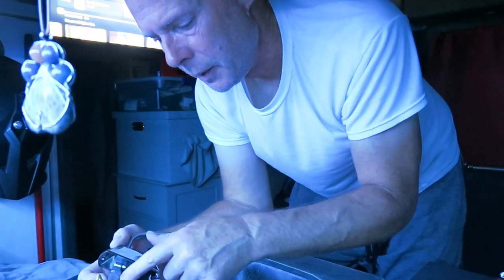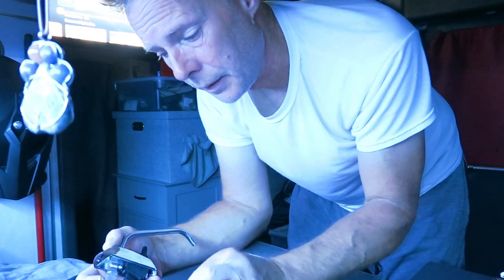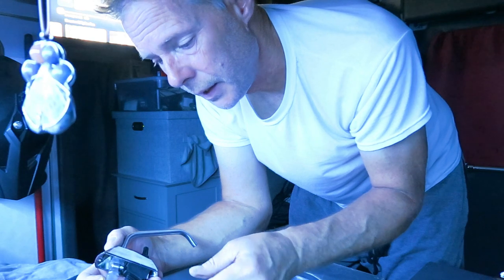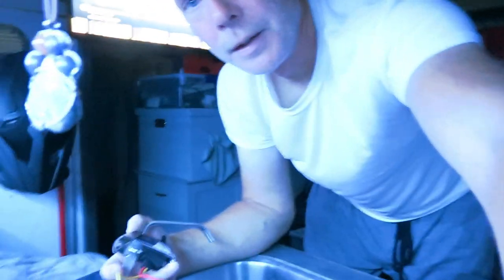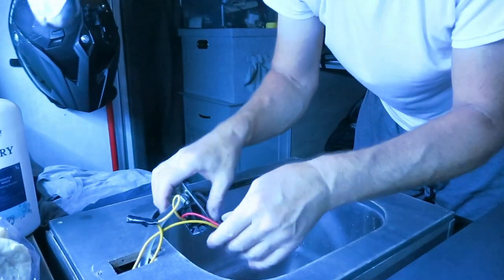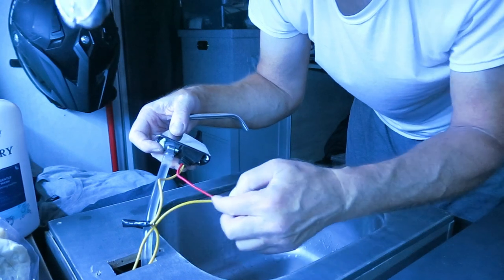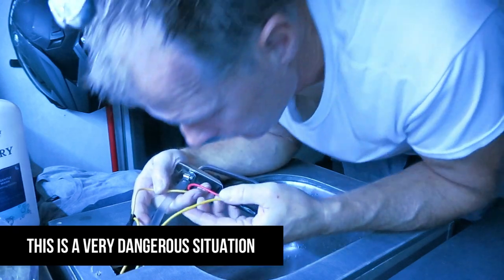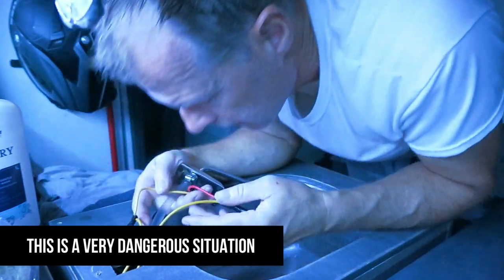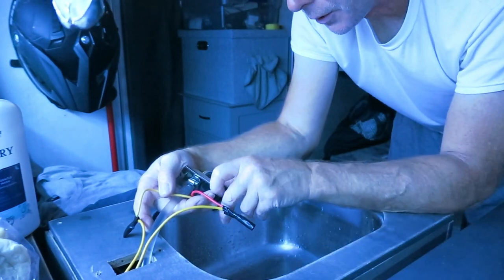So the wire coming out of the switch going into the connection, the temperature is normal, it's room temperature, but then the power line coming out of the connection that goes to the pump, the first couple of inches are definitely warm, verging on hot. See, and then it cools back off after I turn it off.